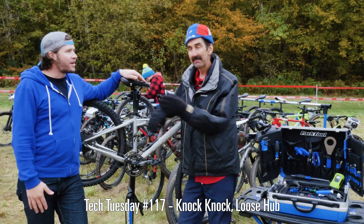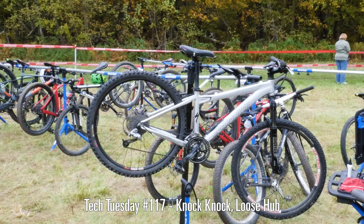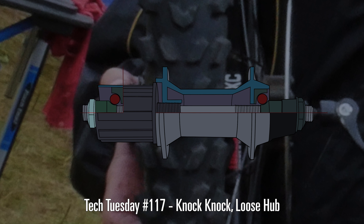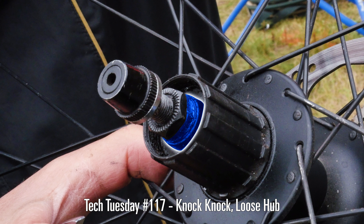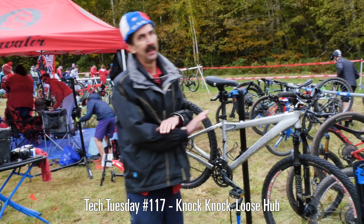Or the time when we taught everybody. Knock knock. Who's there? We have some play in our hub — time to fix the bike. We're at a high school mountain bike race and one of the riders has a loose hub. So the lock nut is loose, hence the cone comes loose. The extra space allows the hub to rock back and forth. So all we need to do on this wheel is hold the cone in its correct place and tighten down the loose lock nut. Fully closed. Knock knock. Knocked. Who's there? Nothing.